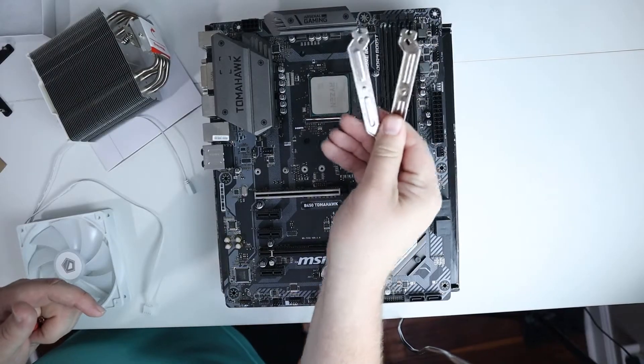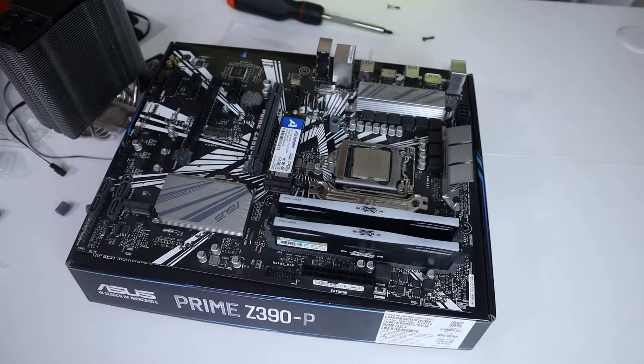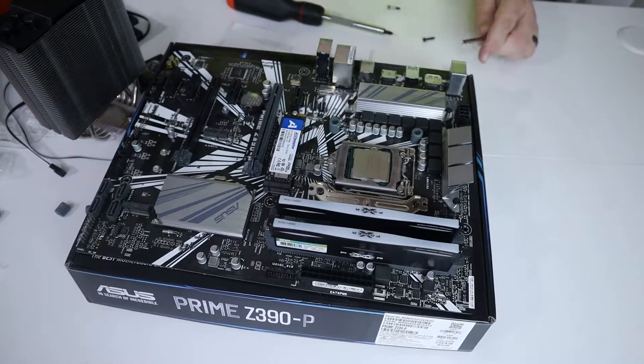You're going to need these two metal braces and the screws that come with the red smooth standoffs. If you're doing a newer AM5 CPU, the 7000 series, read the directions carefully because the standoff is not the red one. For Intel CPUs, we're going to use the gray smooth standoffs.